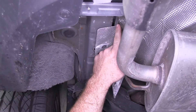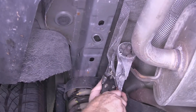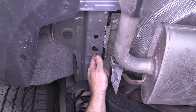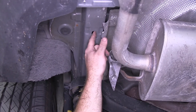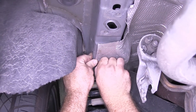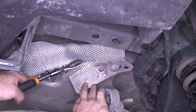I'm going to trim this about an inch past this hole. Now I want to make sure that I have clearance to my larger access hole here, along with the smaller hole that's just behind it on the vehicle. So now that I've got it trimmed, I can put this little nut back on to re-secure the end of our heat shield here. We'll move to the passenger side and trim that heat shield so that we have access to those same holes.